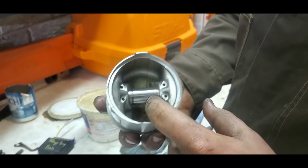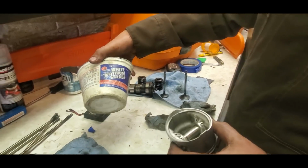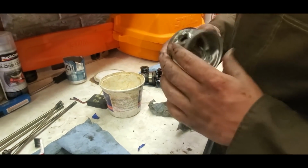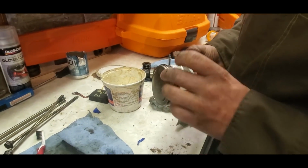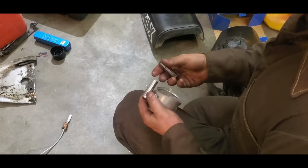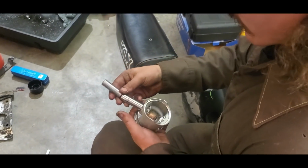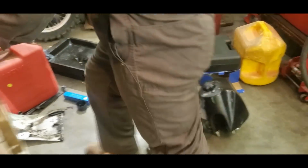So I'm going to take out my wrist pin. I'm going to lubricate that up really nice with some white lithium grease, not white lightning. That's a type of alcohol. I'm going to take this wrist pin out, grease it up, put it in, and you want to make sure that that piston moves freely up on top of your connecting rod. If you're having a hard time removing your wrist pin, take a small, long socket, one that will fit in there, and you can usually drive them through. At least that's the way I do it.